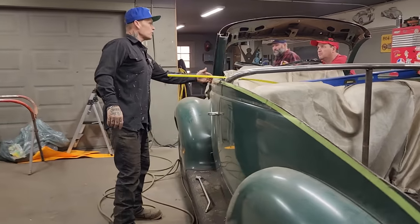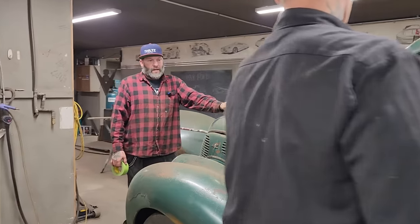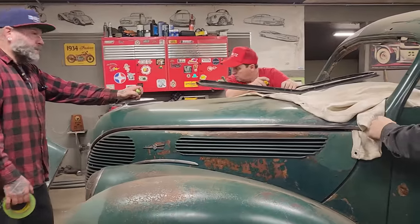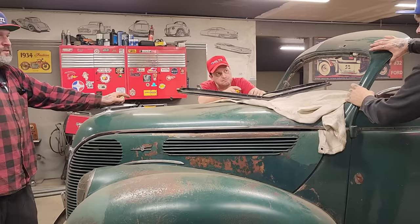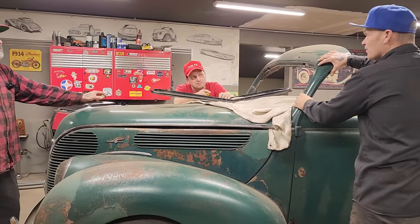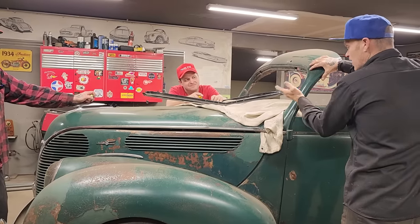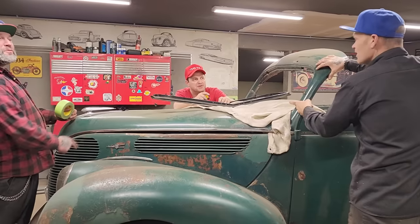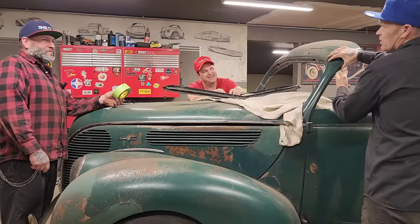One thing, I want the drip rail molding taken off, we don't want that. So a zip cut right inside that. I cut that one off that roof. Whenever you want to do it. And another thing, leave as much paint on as possible. When you make your cuts, cut it with the grinder. Don't nick the paint, just leave as much paint as you can.